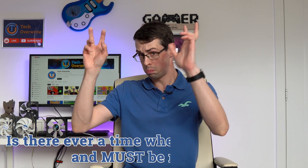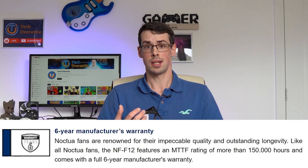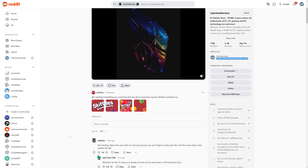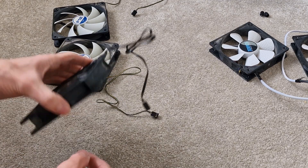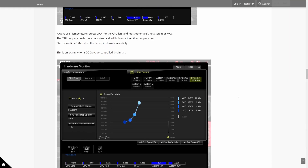To wrap up this video, let's answer the main question: is there ever a time when a fan is just too old and must be replaced? Not really — this fan is still working fine after 14 years. Of course an old budget fan running maxed out all the time might fail after a few years, whereas a higher quality fan might still be working more than a decade on. You only really need to change your fans if they're running much slower all of a sudden, or maybe they become really noisy overnight — that's a sign the bearing is shot. I think it just comes down to: you'll know when it's time to change your case fans. The only other reason is if you have 3-pin fans or Molex fans — you might want to change them out to 4-pin fans to get extra control over fan speeds. PWM fans are so cheap nowadays that I would just look to buy these from now on.